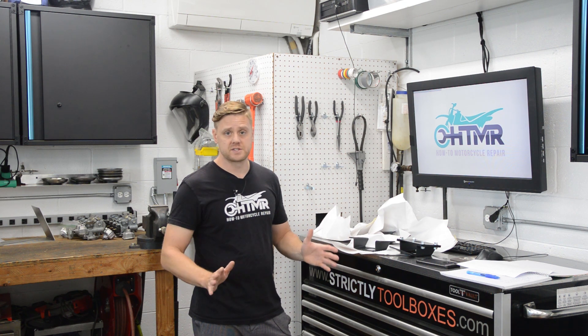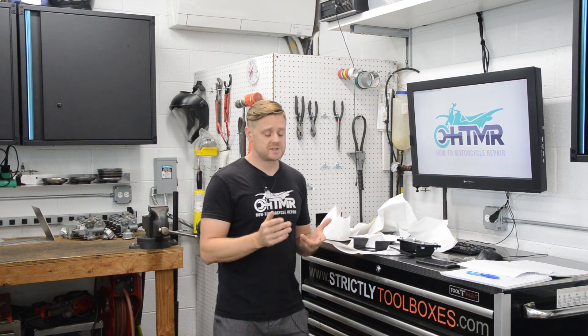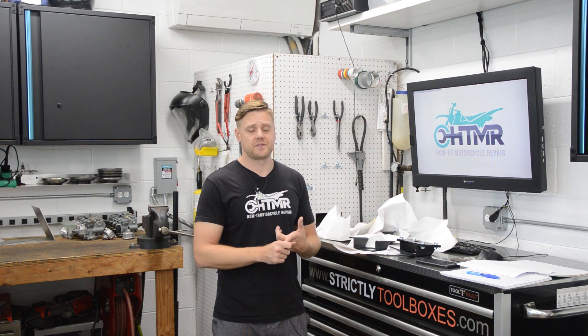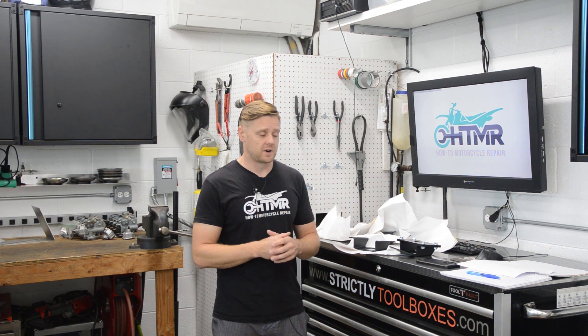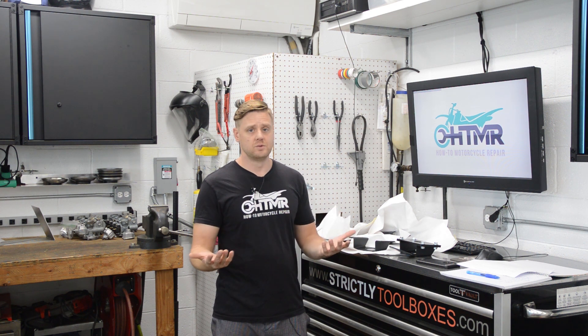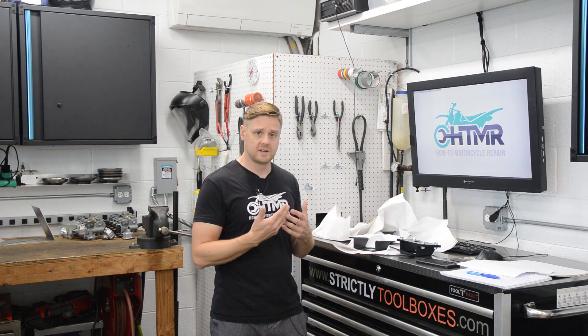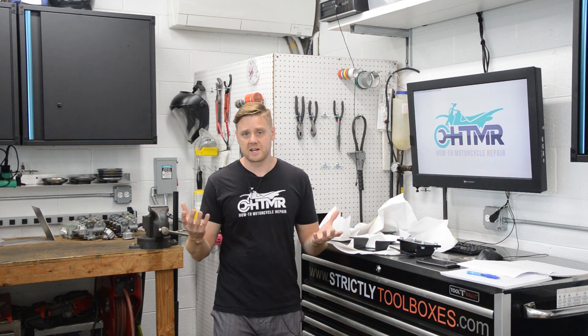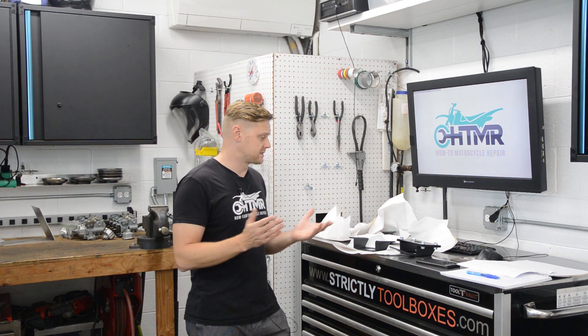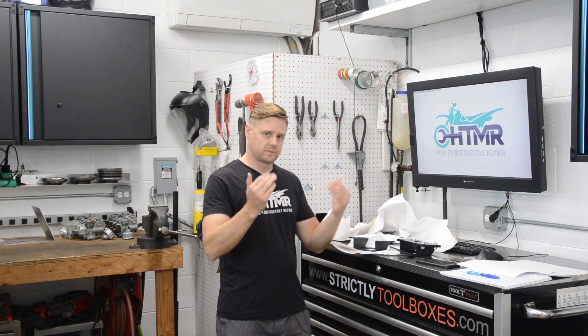Clearance is excellent. You can buy a Hydra Boost kit that comes with everything you need for around $1,000 to $1,300 depending on options, but if you buy this bracket and all the parts I list in my instructions, you come out at about half the cost — same stuff, same parts. The Hydra Booster is made by GM; these Hydra Boost companies buy it, modify it, and sell it to you for more money. That's fine, but I just want to reduce the cost a little bit.